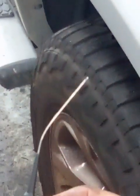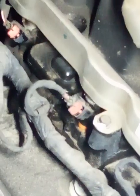So when you're doing stuff like this, you're going to want a back probe. I'm sure you guys know what those are. Let's see if I can find one here. I like using the really long ones, like this. That's the type that I like to use, so I can just reach back there and back probe the circuit. Me personally, I use a lab scope, so that I can see that the computer's commanding it at least, and look for a pintle hump. But I don't have time to go into all that.